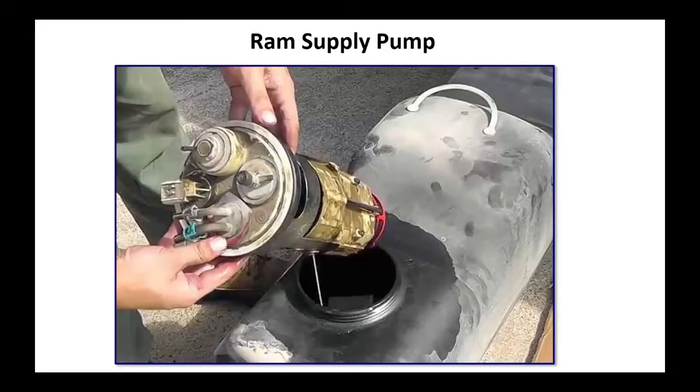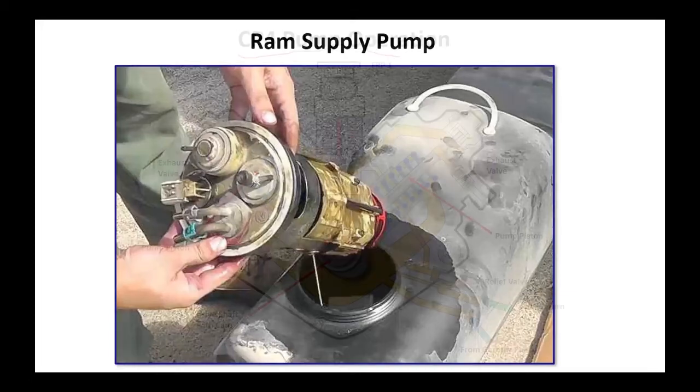Dodge Ram pickup truck. This is the lift pump. Some early 5.9 engines use a supply pump mounted to the engine. They came out with a bulletin saying if that one on the engine goes bad, stick one in the tank. All the wiring was there. Just had to do some plumbing. They once upon a time did have a kit to do that with, but that has since disappeared.